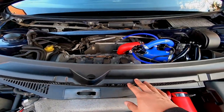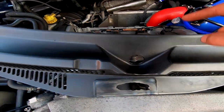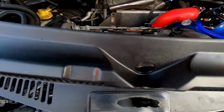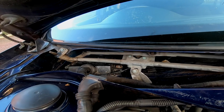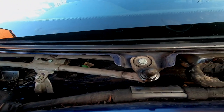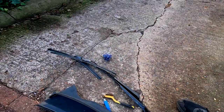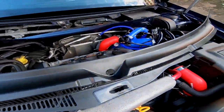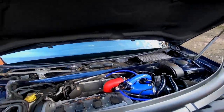Given the scuttle panel a good clean up - I'd like to replace it because the clear plastic that normally goes over the chassis number has gone brittle and literally crumbles. Everything's all sealed up and still drying. I've touched a little bit of silicone around the bonnet release cable grommet. As for the spindles on the wiper linkage, I've put a little bit of WD-40 on them, rubbed them with a wire brush to get any corrosion off, and my wiper arms are all clean. I used my Dremel on the inside of those so all the corrosion's gone and there's a little bit of copper grease in there. Going to put the scuttle panel back on, then the pollen filter tray, then the wiper arms - and then that's pretty much it.